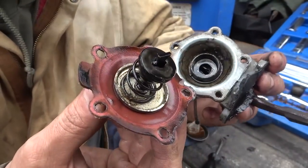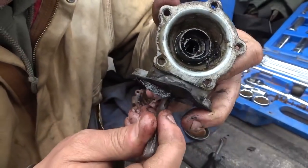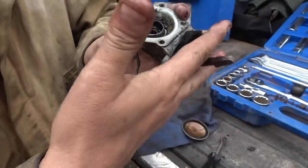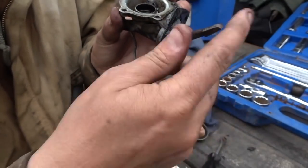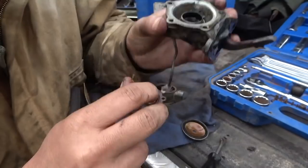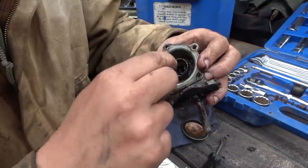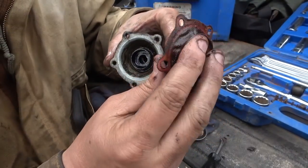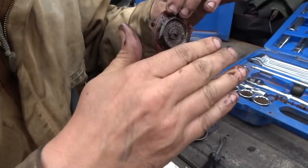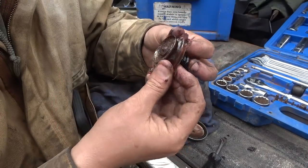So when you remove this, in the bottom you've got the spring, you've got your plunger, and a cam in there — you can see in there. That goes up and down. This is inside the engine block and you've got a cam lobe on there. As the engine's turning, that cam lobe does that — it's exactly the same as when you're hand-priming it, but it's being done automatically, mechanically, off the engine. That going up and down pushes on here with the spring, and in turn going up and down pumps the diaphragm, which pumps the fuel. But this really doesn't look great.